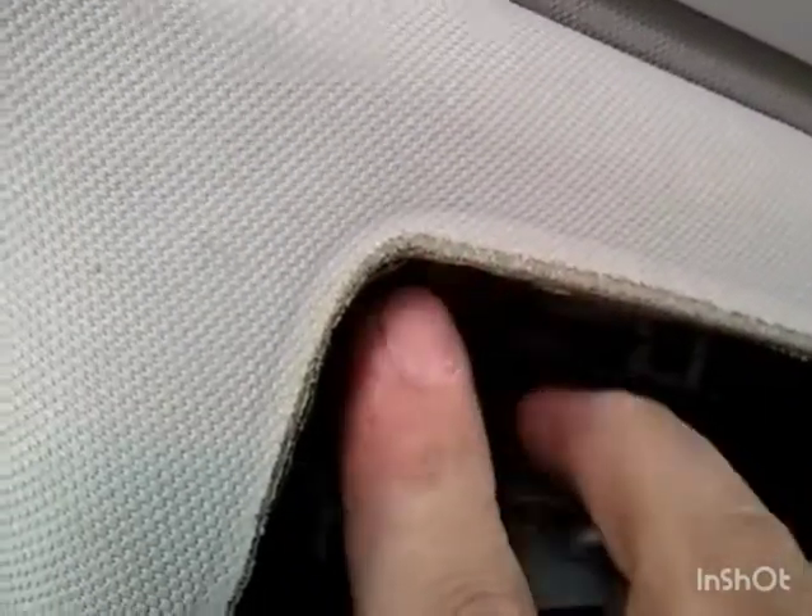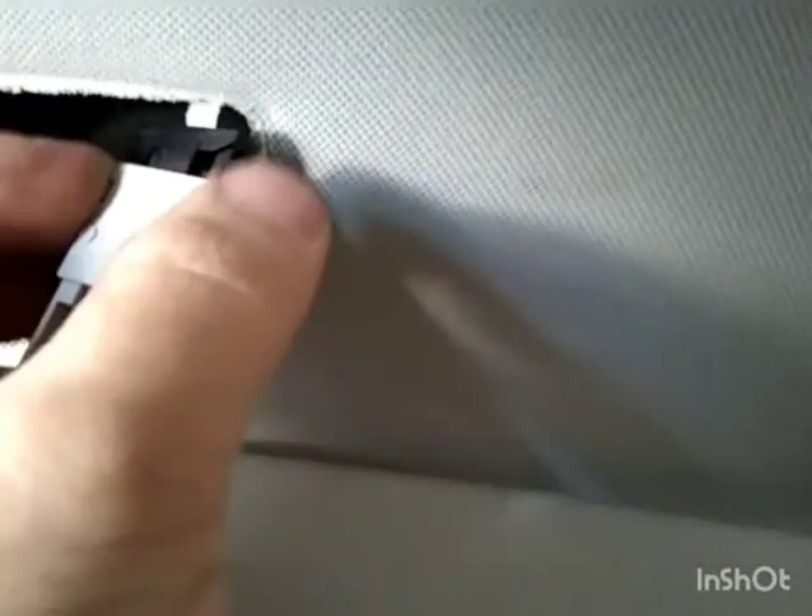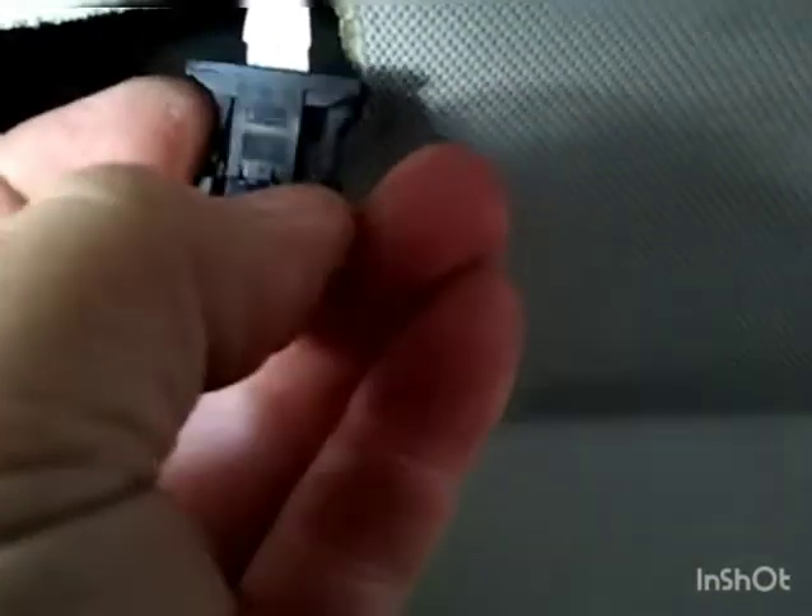If you get this light loose, take a pick or small flathead screwdriver and stick it in from the outside back — there's a little metal tab up in there you're going to push on. It'll come out. Just wiggle it down out, and it's going to have the same style push-together connector. Just push those two little tabs together on both sides — a little pinch and push back. Slip them back up in there so they're out of the way.